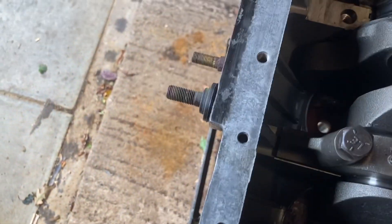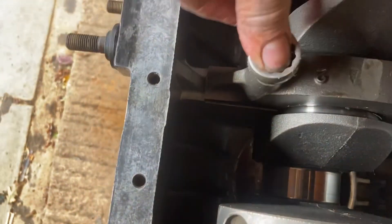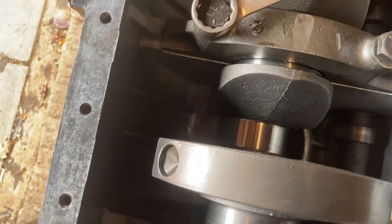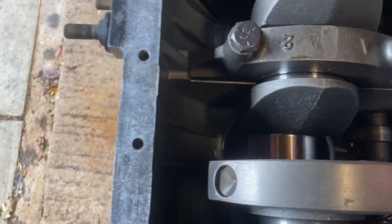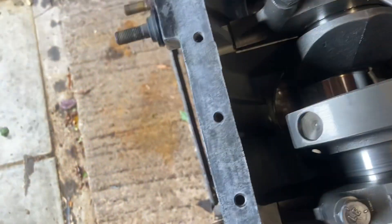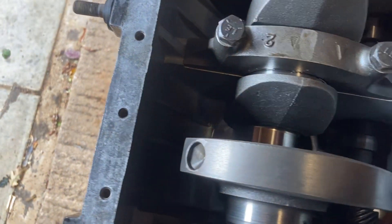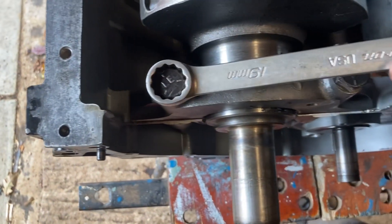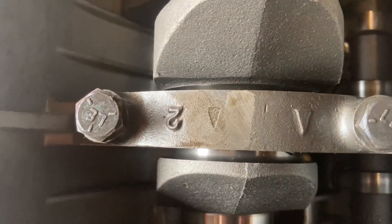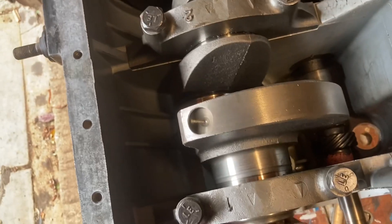As you put each cap on, you just give them a nip down with a spanner, just to make sure it's butted up to its faces nicely. Bear in mind this isn't torqued up yet — I've only got a couple of caps on, so this isn't torqued down at the moment. Once it's nipped down and you're happy that it's all butted up nicely, just give that crank a quick spin. And this is as far as I've got at the moment — I had to dash off. If anybody's interested, leave a comment, and I'll try and film a bit more as I'm putting this back together. I'm not a filmmaker, as you can probably tell by the poor camera and the rubbish voiceover, but we'll see how it goes. Thanks for watching.